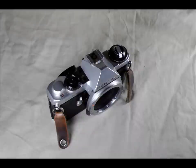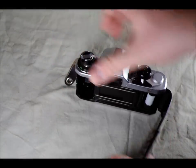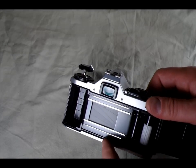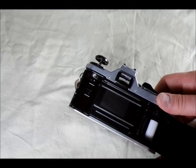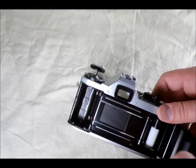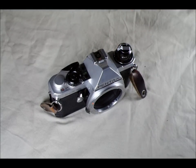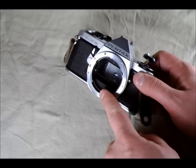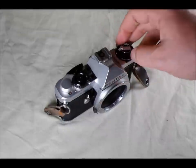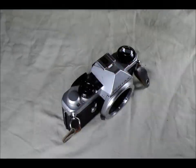There are a few things you should never do with this camera. First, don't touch the shutter — as you can see there appear to be a few fingerprints on parts of the shutter. If you touch it, or put your finger through it while it's open and it then closes, that's a really good way to ruin your shutter and brick an otherwise perfect camera. Also, don't touch the mirror inside the lens mount, because your finger oils can take the silver off of it, which will make it hard or impossible to focus and will make the viewfinder image a lot dimmer — making focusing even harder.